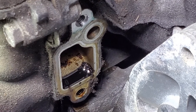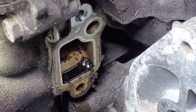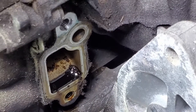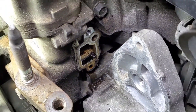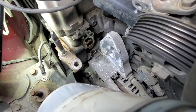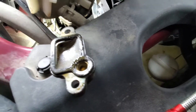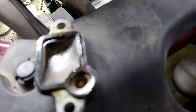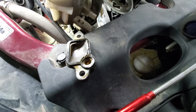That's the screen on the front — I got the screen part off and that little plate off for the VTEC. It looks like there's a bunch of crap in there. I dropped the little plate down the side of the engine, and a bunch of the crap probably fell out, but this is the screen here, and it looks like the screen is broken. I'm probably going to have to order that part, because I don't have one.